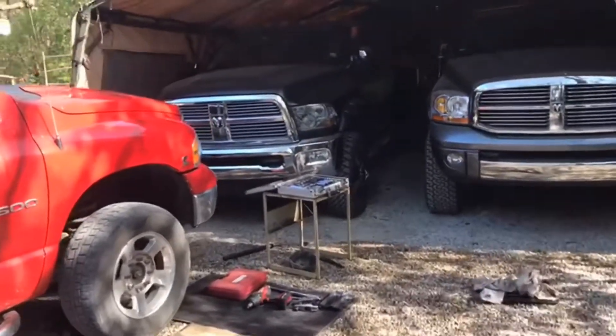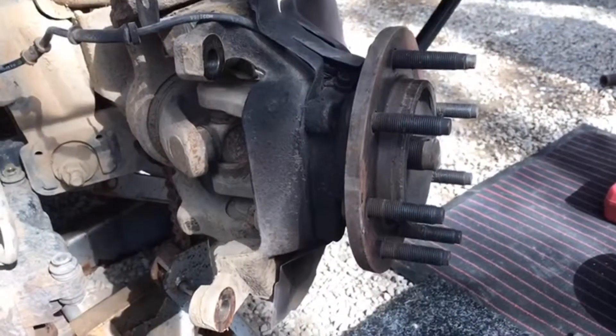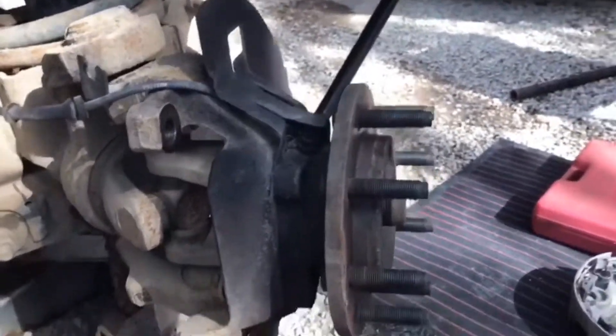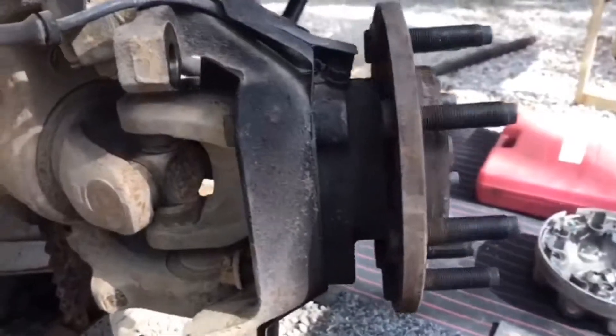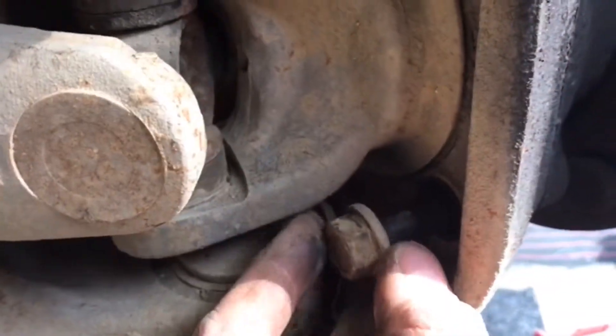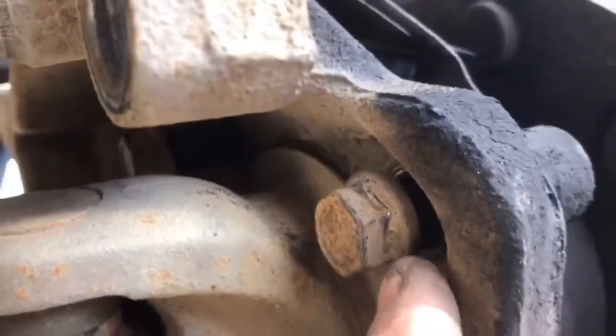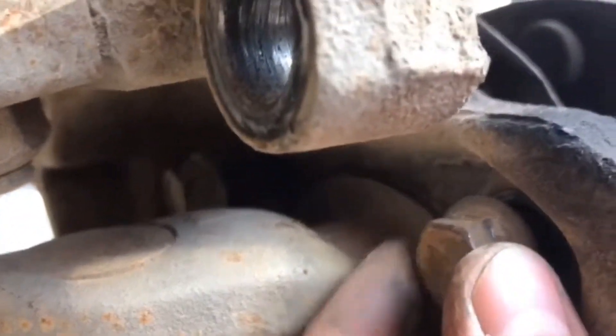Join time for the passenger side, here we go. The procedure is the same. On the passenger side, as you can see, I'm going to take the lower bolt completely out. The top one I back out about 10 turns.